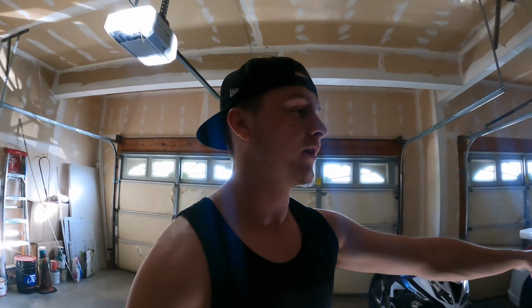As far as a turbo kit goes, you're just gonna have to up the injectors, you're gonna have to up the turbo size. Anything that comes off the shelf is probably gonna be like a 700 wheel horsepower max kit out the door. So that's why we're gonna go custom with this.